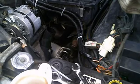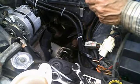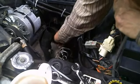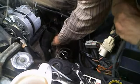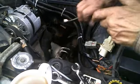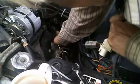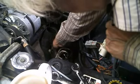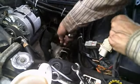That's the difference between 15 millimeter and 5/8, which is why my 5/8 wrench would have that little slit, because we had about half a millimeter difference. So let's see if we can get this cracked free now that I found the 15 millimeter wrench. As you can see, the manifold's in one direction there, and the power steering pump's in the other direction. Too bad the wrench isn't designed so that one could go down in there. This is the whole reason I put my car on the ramps, because with my bad condition it's too much of a bend over for me. And you can see, I can't even get that 15 millimeter wrench on there.